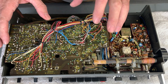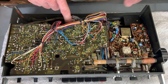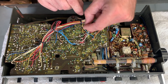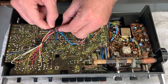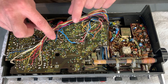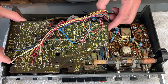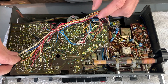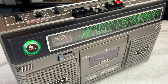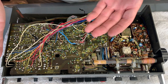You can actually remove different screws that take the mech and the board out in one piece, which you may see in my other video, but today we're just going to access the underside of the board so we don't need to get the actual mechanism out. The board itself is fairly happy and wants to come loose, but it can't because these two white cables are the wires that go to the APSS light. It's far easier just to desolder them and move them out of the way, then peel the board back.